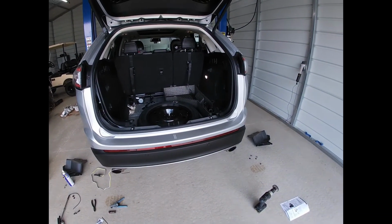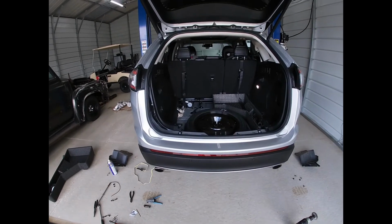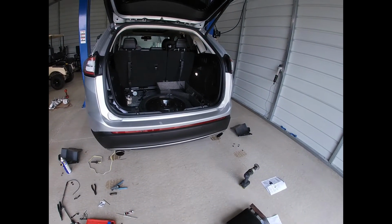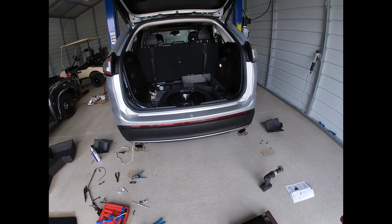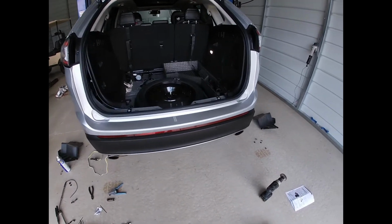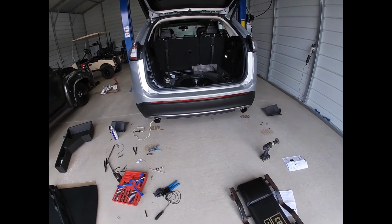And even though this car only has 25,000 miles on it, being a northern car, some of the fasteners are very rusty. So you might have seen me under there with a wire wheel cleaning the fasteners off. That's a good way to get them off without twisting them off, because if they break loose, tighten up, they'll snap off. So if you wire wheel them and spray a little WD-40 or some kind of penetrant on them, they'll come off. Other than that, stay tuned and I'll bring you the next one.